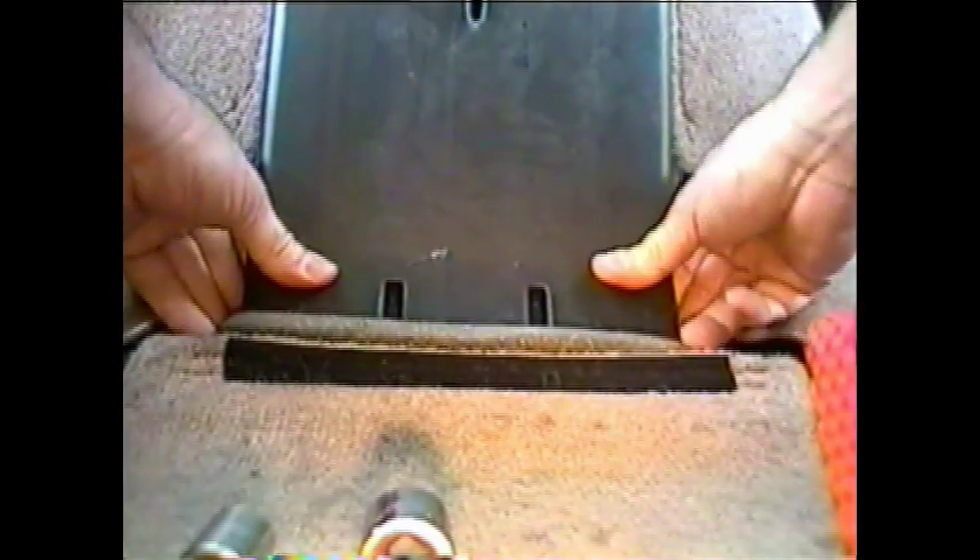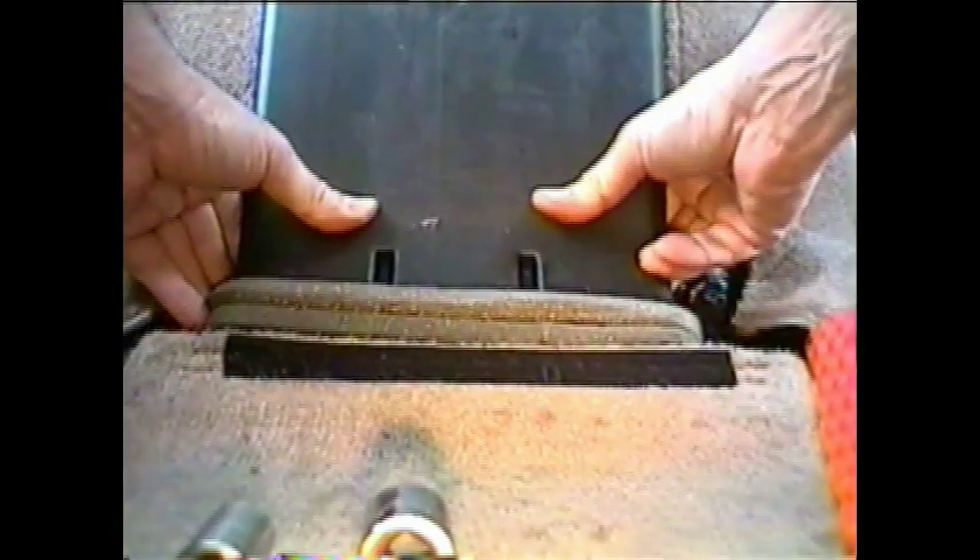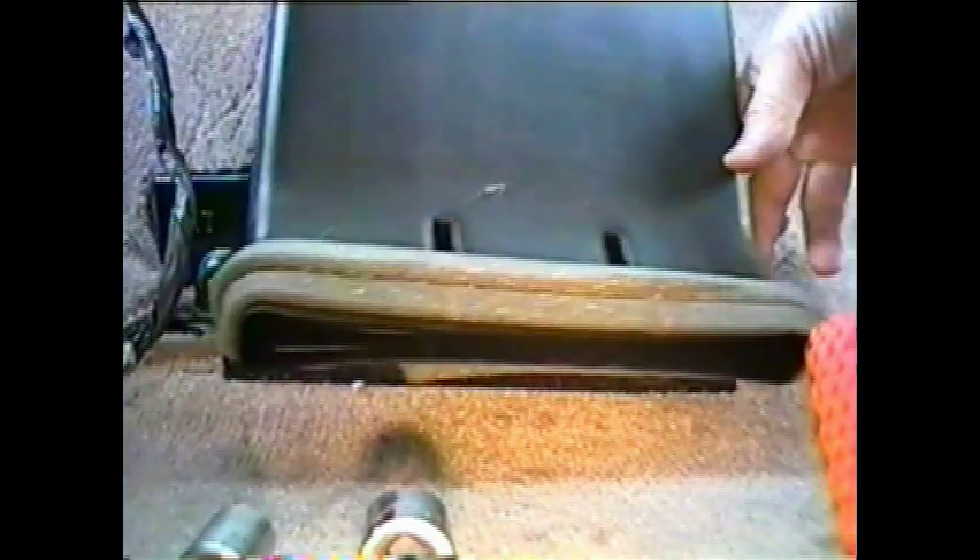That ducting handily feeds the rear of the vehicle. Lift this up and force it out. There's a little connection at the top — it's right there — make this loose and it comes out, and it just slips into this right-hand side. So once this air conditioner duct is untangled and comes out, the cowling is free.